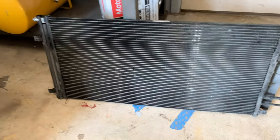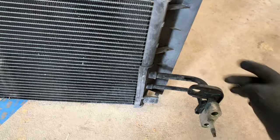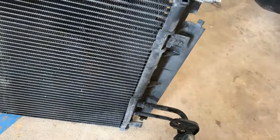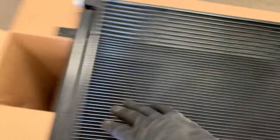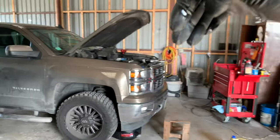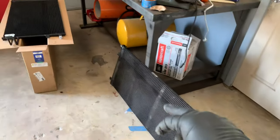We're almost done — just going to move that clip and then we should be able to pull it straight up. Here is the old one, I already pulled it out. It was leaking from right here — this is the outside of it. This one did have a 10 millimeter bolt here, then I took off the nut on the stud. On the new one I'm not going to put the stud on until I slide it in. I removed these plastic pieces from the bracket here — these are so air flows through properly — and I'm going to transfer them to the new one. I'll put that one here and this one here, but I'm not putting the stud on until it's in because that stud sticks out this far and I did struggle a little getting it up through there.